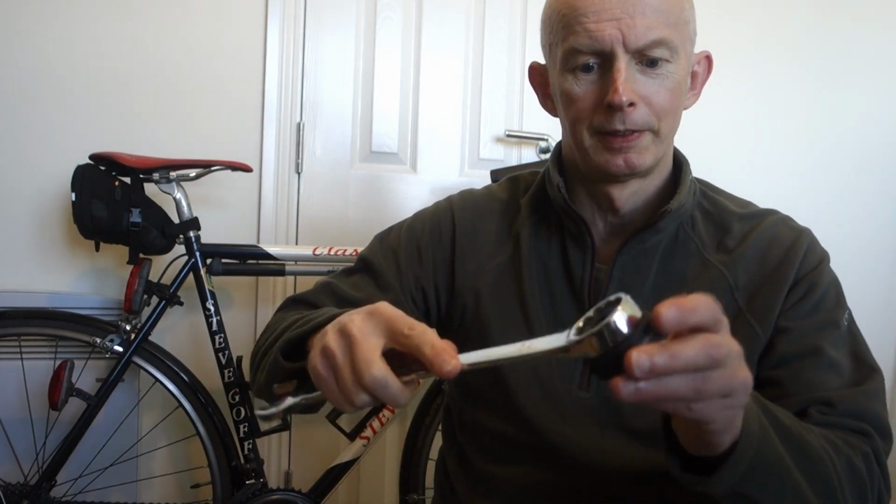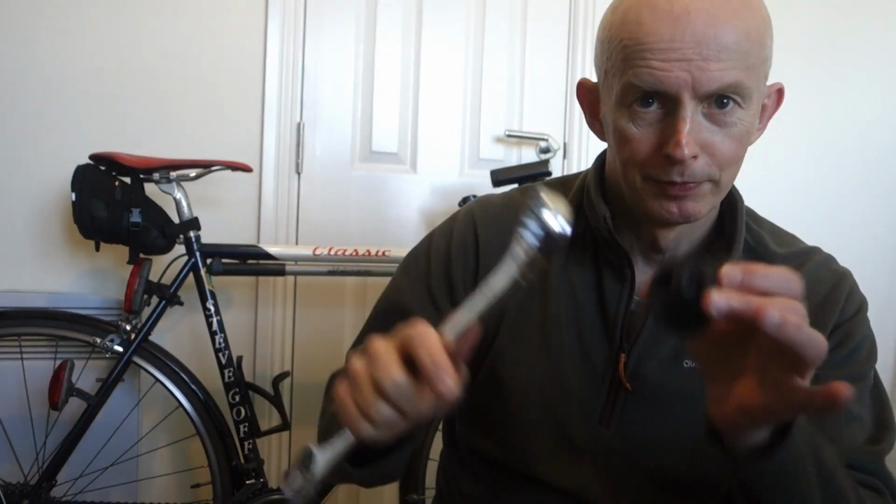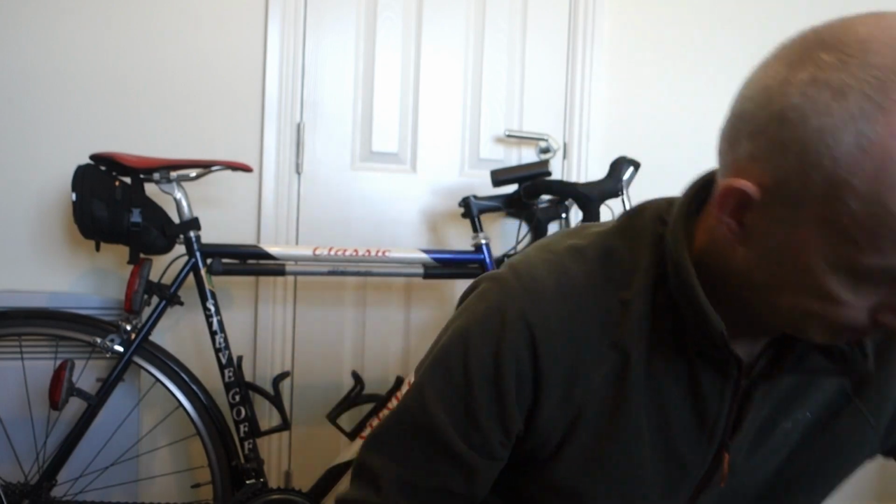So that is why I bought the, well, it's a Lifeline one. I thought it was a Lezyne. They didn't have the Lezyne full tool, and it's got a 1/2 inch drive square in the middle, but it's also got a hex on there, so I can put on a big 32mm spanner, and I should be able to take the cups out and then check it all, re-grease it all, put it back together. That's the plan anyway, so let's get into it and see how we do.